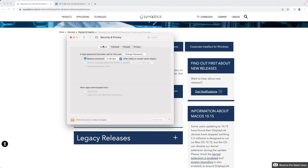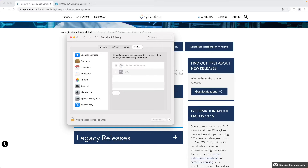It might take you to this screen initially, and you have to unlock it using your password, fingerprint, or biometrics. Then go to Privacy, scroll down to where it says Screen Recording. If you've done the download correctly, the DisplayLink Manager option will be there — check the box. Make sure your displays are on the correct output: if you're using HDMI, specify HDMI.